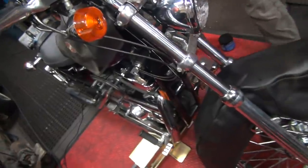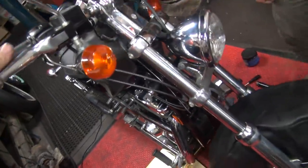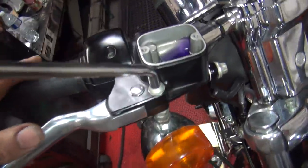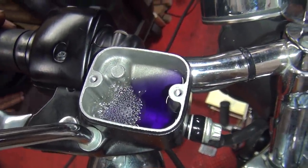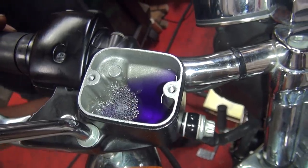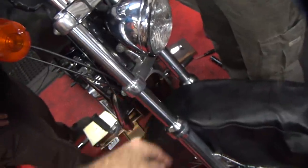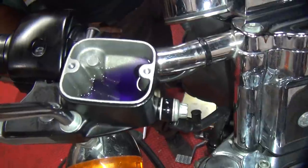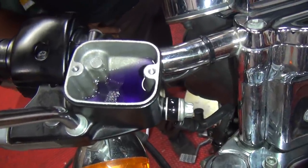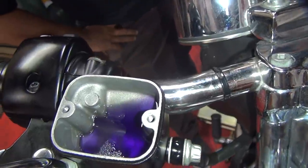Okay, give it a little wiggles down there. This will be soft, soft, soft, and all of a sudden they just get hard. And they'll stay that way because all the air will be out. Every one of those air bubbles is more fluid that went down the line. And we have to fill this whole long line, so it's going to take a lot of fluid. You can notice we've gone through a little bit of fluid. You're going to have to refill it soon. It's a big reservoir.